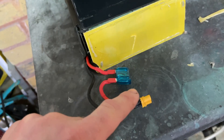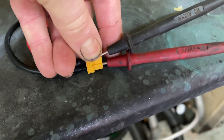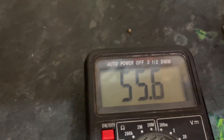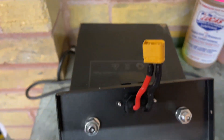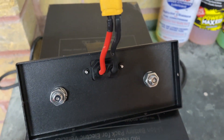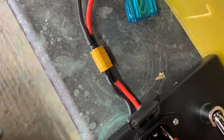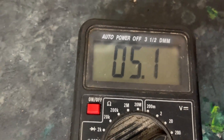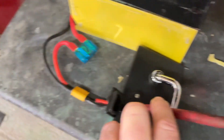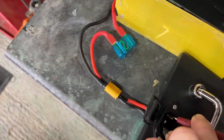If I put the voltmeter on it, I'll show you what the problem is. I've got a multimeter with polarity the right way, and straight over to the voltmeter. At the moment, coming out of the battery it's got 55.6 volts. Now let me plug in the connector and measure it on the prongs that go into the bike — the red wire is positive, the other is negative. I've only got five volts, so the problem is either that connector or this plug.